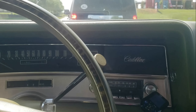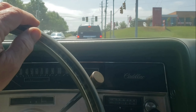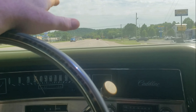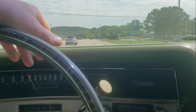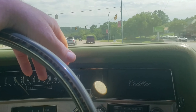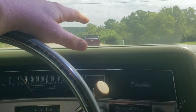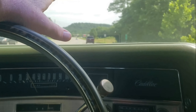We're out and about. I did a fair amount of tuning in the garage earlier — the results are mixed. I'm not really impressed with how things are going, to be honest, but I think I'm going to leave it. I was not having a dieseling problem before sending it off, and now after the rebuild I'm having a run-on dieseling problem. The dieseling solenoid had been removed a few years ago — I still have it and could reinstall it.